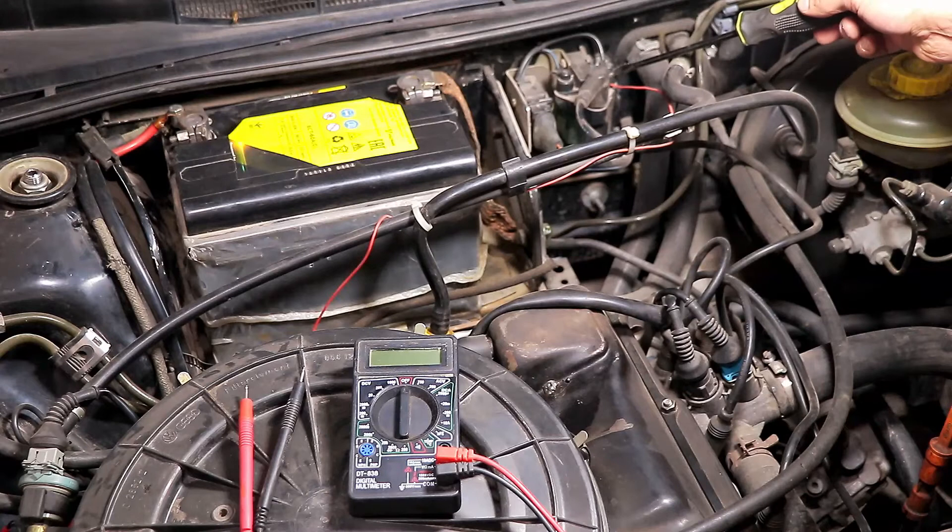To protect our battery from draining, we can connect the supply wiring of the TPS in another way. We should connect it so that when we turn on the ignition the supply voltage is turned on, and when we turn off the ignition the supply voltage is turned off. All we need is just to find some point under the hood where we can take the supply. The simplest way is to connect it to the supply wire of the ignition coil, as you can see on my vehicle.